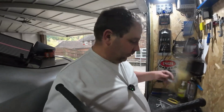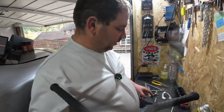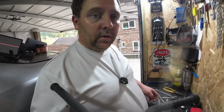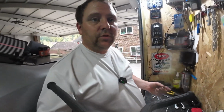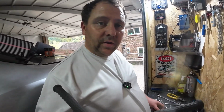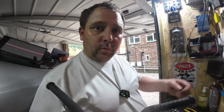So if you do it this way around, the way I've done it, that last bend, don't bend it until you've flared it, if you've got that other tool, because this one's a pain in the ass to use. So maybe I should get a bench vise and give this one a bit more of a go, but I've got to trim this end off and put this little bit in. See, not a pro, we'll make mistakes.